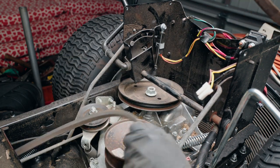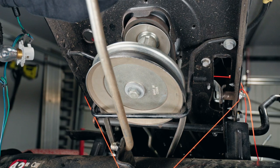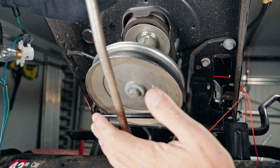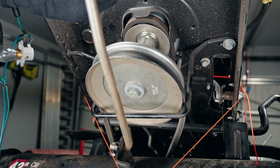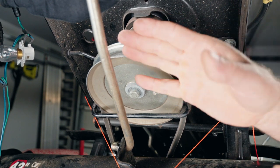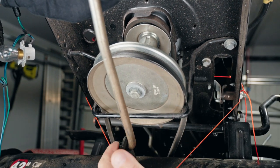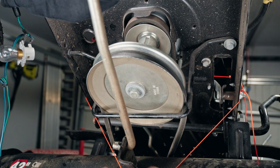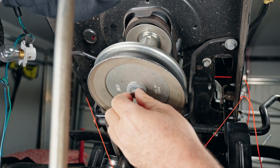The front belt is loose; we just have to get it loose from around the engine. If you've got your mower jacked up in the air, I don't like to put stress on the deck, so I went ahead and put a piece of string here — it's actually pretty strong. I went ahead and pulled the cotter pin out right here so that I can pull that rod out and get it right out of the way. Now you've got access.